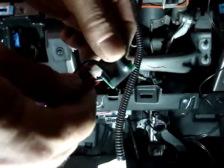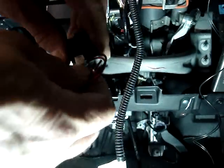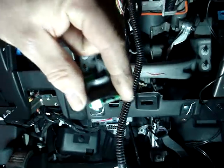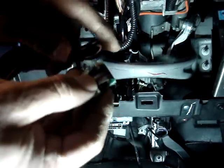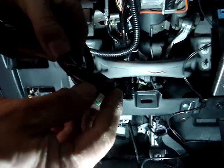Okay, first of all, with the data cable box here, we're not going to need the power plug for this application. Power is going to be supplied through the T-harness. I want to take the harness, the EVO-All, and we're going to find the plug that's zipped up to the back here if you're upgrading a system. If you're adding it, we'll already plug this box in for you. I'm going to basically plug it into the end with a clip. We're going to lock it in.